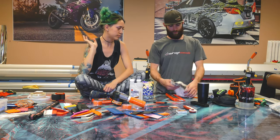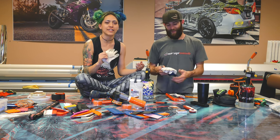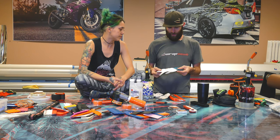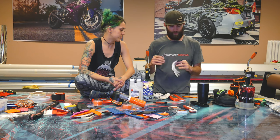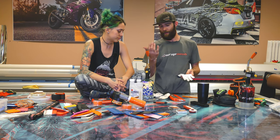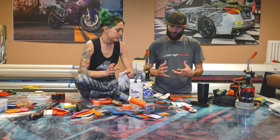Yeah, I guess one last thing is gloves. I mean, gloves are a huge thing. I don't like white gloves because they get so dirty. Yeah, they do get dirty, but these gloves are so awesome. These Ghost gloves, this is my favorite. This is what I use. This is an Oracle one, we got this from our certification class. It's just a nice dry slide glove, and it really helps when you're pushing out stuff with your palm. If you need to get a nice recess, these are great. You can rub out some bubbles and stuff with that without actually harming the film.